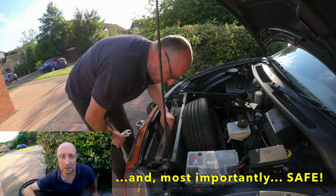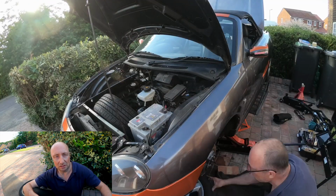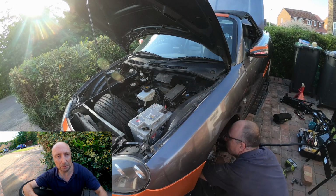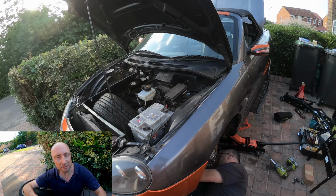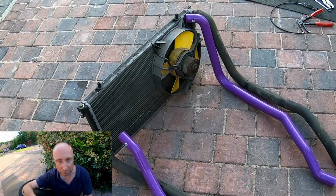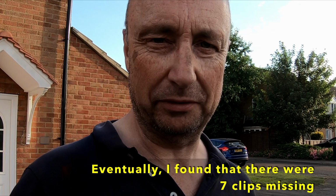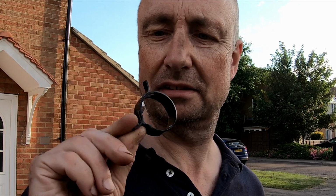I've also taken the two radiator hoses off of the undercar stainless pipes and drained the coolant, and I'm now getting ready to take the radiator hoses off and replace them with the silicone ones. One thing that is slightly annoying and is going to stop me finishing this tonight is that the kit should have 4 of these left and there's only 2.